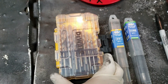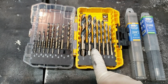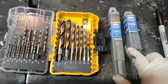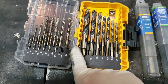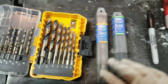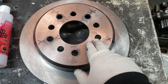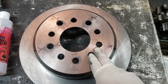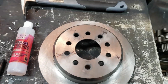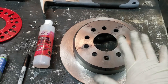Most important thing: I got new drill bits. I got these DeWalt gold-and-black ones — Black Friday sale, I got them for like $6, they go up to half an inch, and they worked really, really well. I actually had to go up to a larger size, 15mm, so after the half inch I bought a 9/16ths and a 15mm from Drill America — cobalt bits, and they worked really well. Like the other video I followed: take your time, let the drill bit work itself in, and you'll feel it catch. Once it catches it goes in smoothly. Don't force it — if you force it you'll put stress on the drill press. Mine was giving me problems at first so I had to fix a couple of things, but once I got it going it was great.